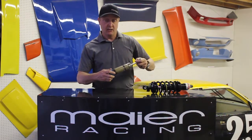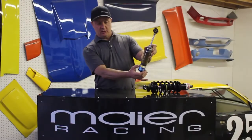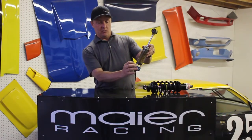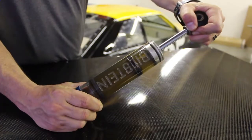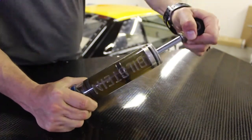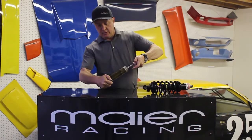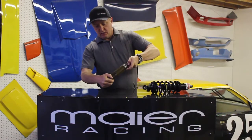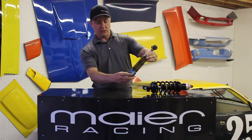It's not controlling the rate in which things move consistently. You see there's a space in the bottom of the shock where there's a gas charge, and essentially the gas charge is now stabilizing the fluid. So as the piston goes up and down you don't see the same air and oil mixture like you did before.